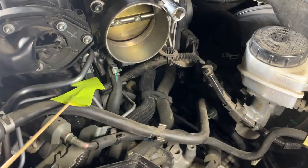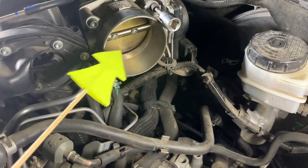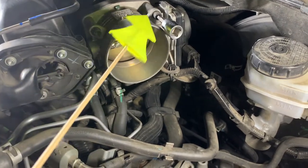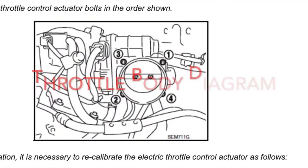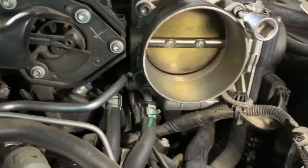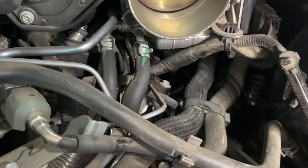So now you have your two coolant lines that I'm just going to leave connected. And then you have the access to the 5 hex Allen bolts right there. I'm going to take those off and probably clean out that throttle body with the toothbrush and air intake cleaner. So 4 bolts, that's a 5 hex Allen wrench. And beware of that bracket on the lower right throttle body bolt. It has a bracket with some wiring on it, so that'll have to be connected correctly.